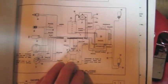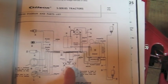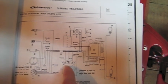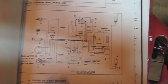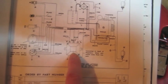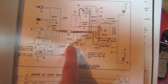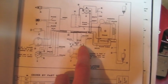Let me show you the diagram again. Here's your voltage regulator — there are four terminals: one on the back and three on the front. Inside the voltage regulator there are a couple of contacts. I took it apart and used 600-grit sandpaper and cleaned those contacts because they're always arcing and they probably get dirty — that might be a problem too. So clean your contacts first, then put the cover back on. On the back of the voltage regulator there's a terminal — that's your generator terminal. Over here you have L, that's your load; you've got B for battery; and F, that's your field.